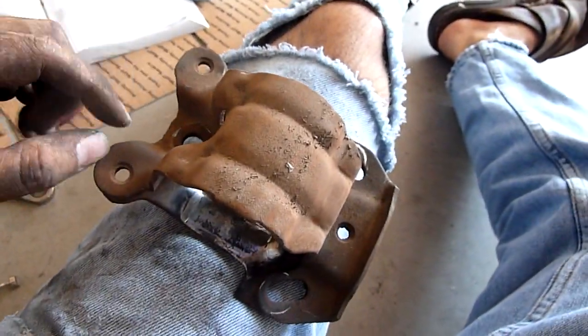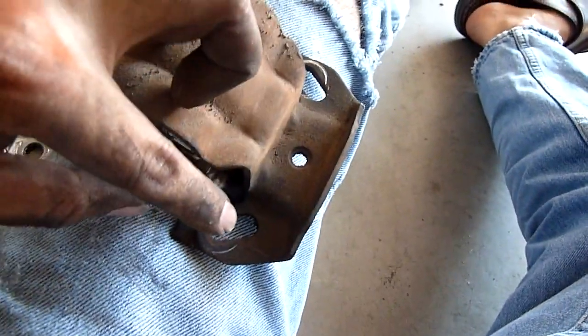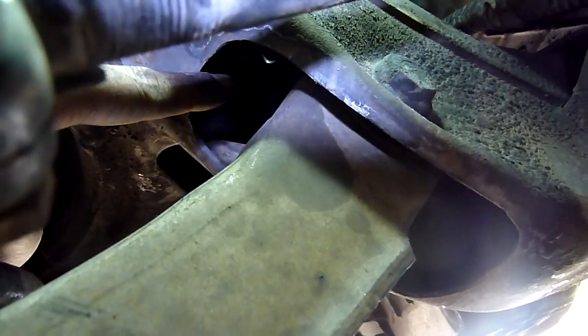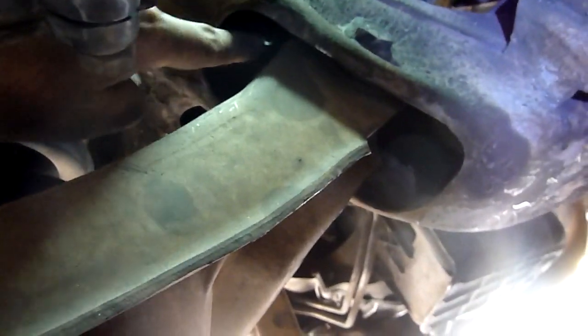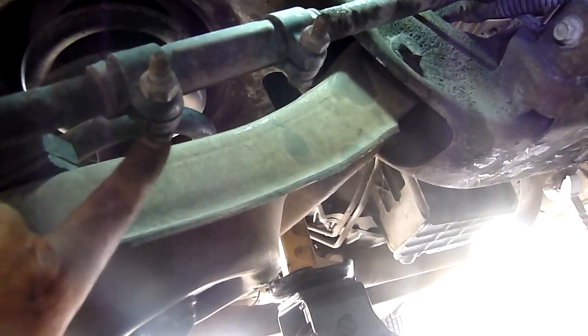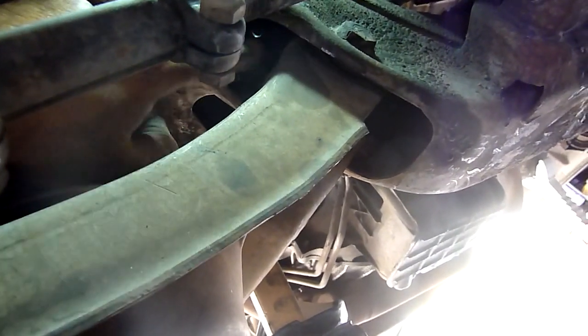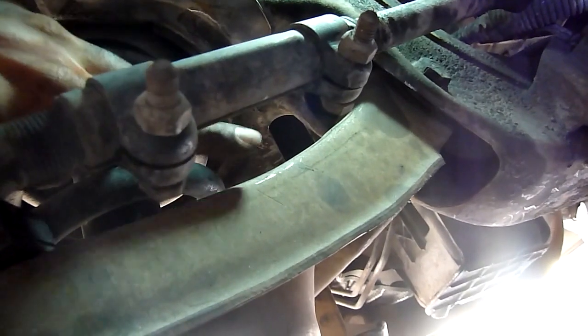This is the mounting device — there was a bolt through here and then two bolts through here. You get to this bolt through the bottom, going through this point right here to get to the bolts that are inside. You go through here between the lower control arm and the tie rods, then through that slotted hole to grab the lower back bolt. Lower front is through here, and lower back is through here.